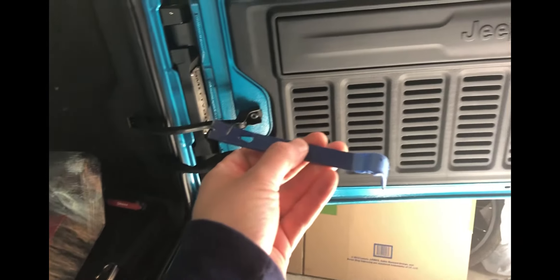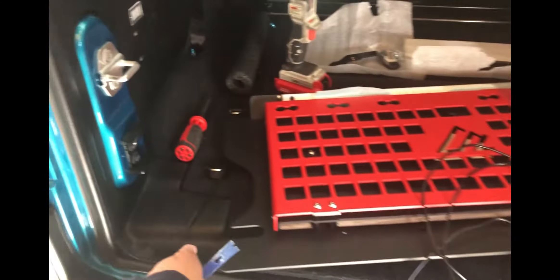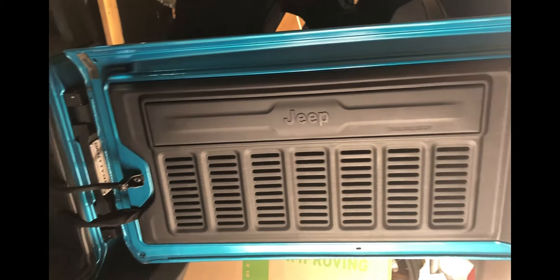Let me go ahead and get started. I'll untape this and use some trim tools to take this off. We'll probably end up taking this panel off just to get the wire fed through here. We'll take this out just to give us more room. There's another trim panel here that holds the bolts if you're unbolting the top of your Jeep or something like that. I'll take out this panel here just to get to the wire - pretty simple, just pop off this little seatbelt panel and wiggle your way out slowly without trying to break anything.